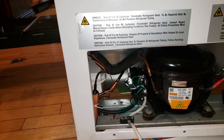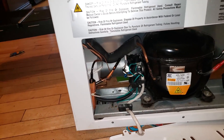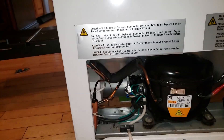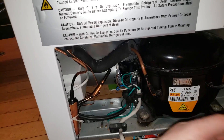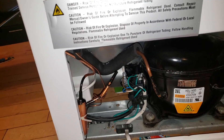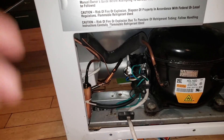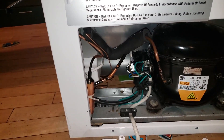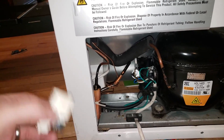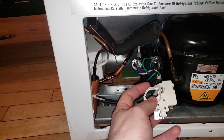I was having a problem where one day I noticed it just didn't freeze anymore - it was getting warm in there. I opened up the panel - three screws to open this thing up - and realized the compressor was getting pretty warm but was never kicking on. I would hear clicks but it would never kick on anymore. Through some research, I found out that normally has to do with the starter relay or the PTC.